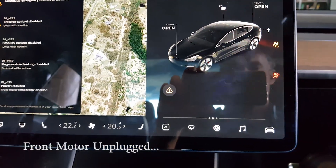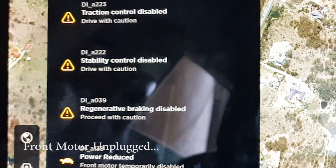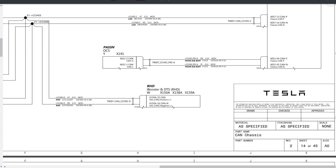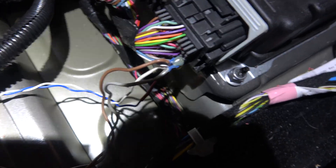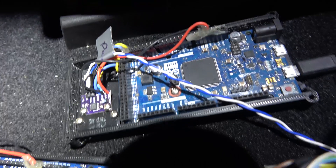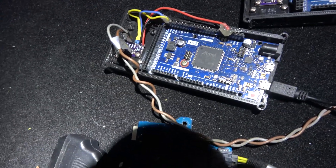I won't need to use the front motor, but I will need to emulate its signals so the vehicle computer doesn't detect a missing front motor. This will be done through the vehicle's CAN bus network. The Tesla Model 3 has three main CAN bus networks: a vehicle CAN, a chassis CAN, and a party CAN. The vehicle CAN bus wires can be accessed with an aftermarket adapter at the back of the center console. The chassis and party CAN buses were trickier — I tapped into them at the restraints control module, which sits underneath the center console.